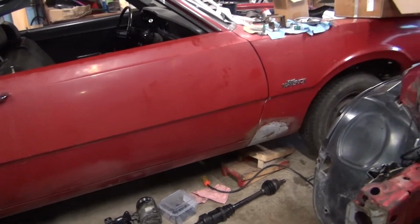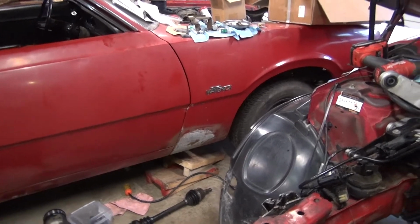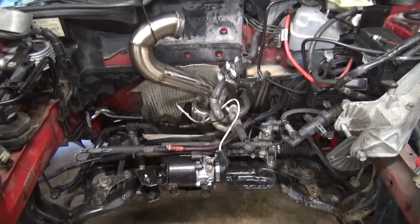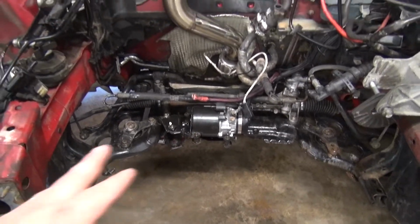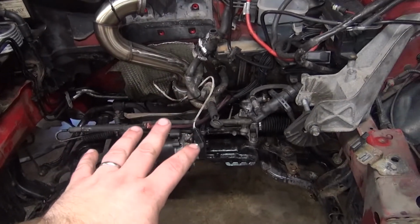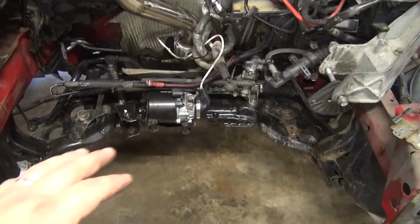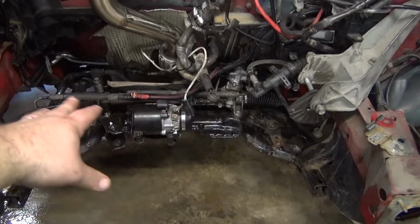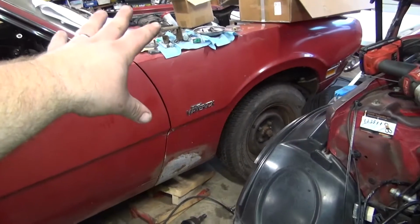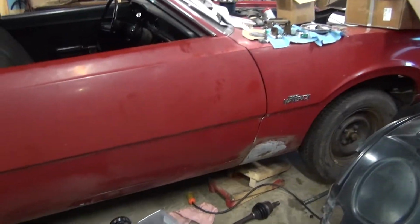But I have a guy sitting over here that needs power steering. He has the old school style rack and pinion setup with a mechanical gearbox. So the Parts Mini that I have, I need to double check all my measurements from tie rod, but I believe the length of this is almost the same length as that. So the Parts Mini may lose its power steering setup, and I may graft it into this car, which will give me power steering, which is awesome.